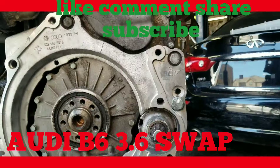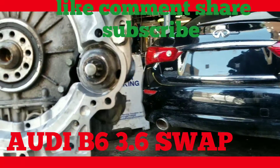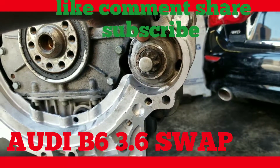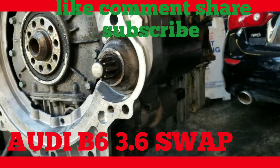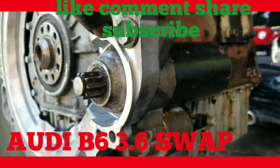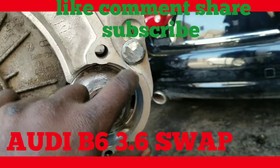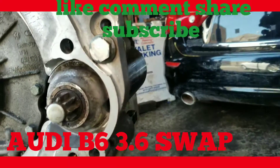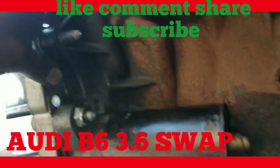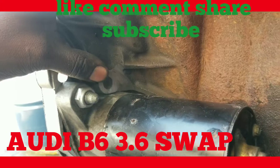The starter for this is expensive as shit, so I decided to skip a step. What I basically did is modified this. The starter is from a 12-valve VR6, and I basically drilled an extra hole through the adapter plate for clearance here so it doesn't touch. Then added a stud with clearance — a block right here, as you can see.